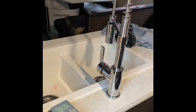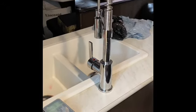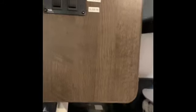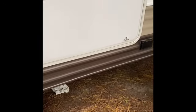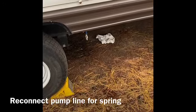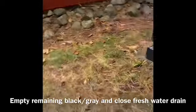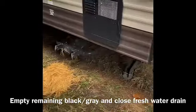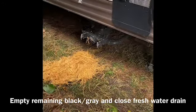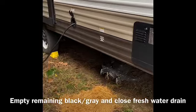Working on some final procedures for winterizing. We've poured the remaining antifreeze in the traps, turned the water pump off, took the pumping hose out of the pump system, and reconnected the pump line. Fresh water is draining out of the fresh water tank — we don't want any fresh water left in there. We also emptied any remaining black and gray water from those tanks and closed them up. We're just about ready to put this thing away for the winter — see you on the other side!